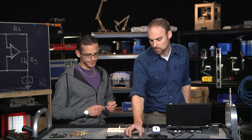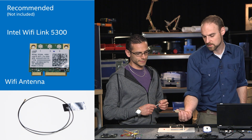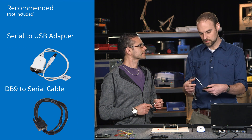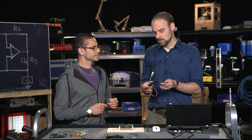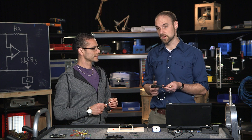I also have a little Wi-Fi card — a Centrino Wi-Fi card — which is about $20 and I got it on eBay. I also have the antenna. It's important to note that having two antennas really gives you a much better signal; I wasn't able to get it to work with my home Wi-Fi until I had the antenna. I also use this serial debugging cable a lot to look at what's happening on the Linux console. This is a serial to USB adapter with a little chip inside, so you need a driver for this cable. And this is a DB9 to serial cable — so that's not an audio jack on the board, it's actually a serial debugging port.